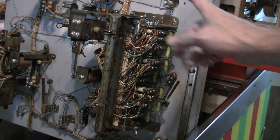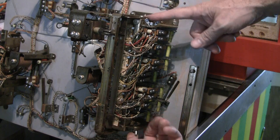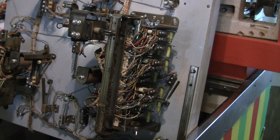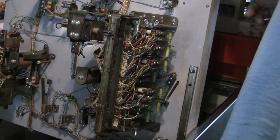There are going to be a bunch of switches that need to be cleaned. This is one of the switch banks — I can undo these two screws here, flip it out, and service both sides of it. The game seems to be working fine. I did notice that the ball stepper unit is, as is typical, malfunctioning, but I'll get to that. So that's where I'm at with this game.